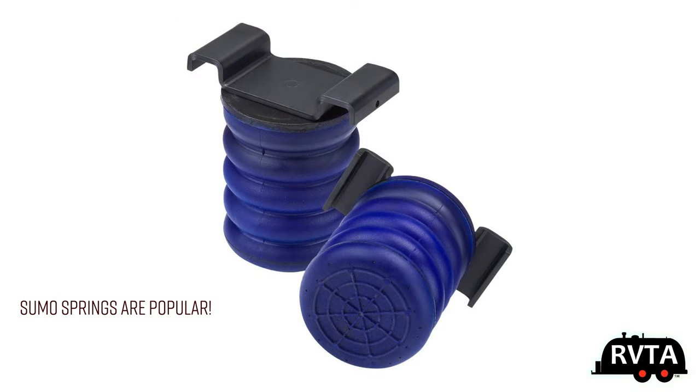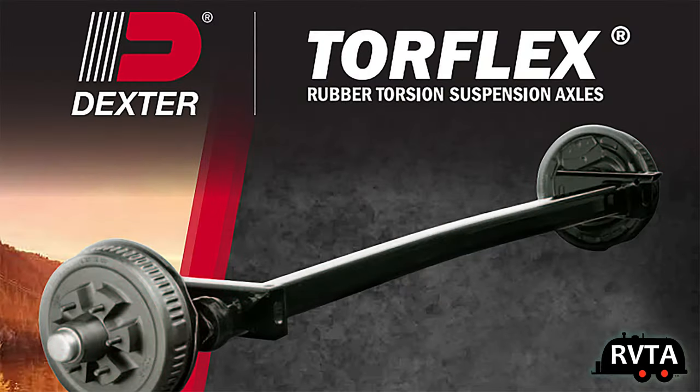An upgrade from there, used by Airstream and Rockwood and some other manufacturers, is the torsion axle. Basically, they have rubber internals for the axle, which creates a torsion effect when you twist it. On each wheel, they have a little lever. The right one goes up, the left one can go down.